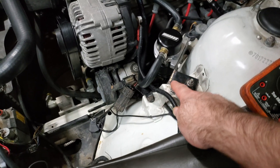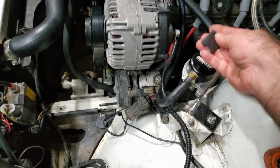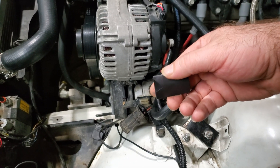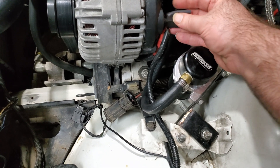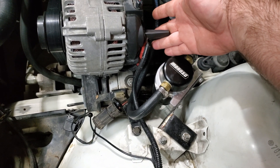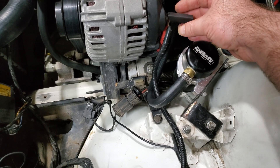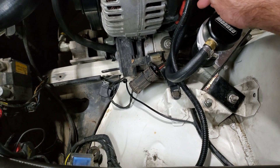Now I did move this back over here a bolt because I'm kind of weary of this pole on the alternator. So I cut off a piece of heat shrink, cut a little divot in it for the cord to go, and do my best to cover it just the best I can to protect it in case a motor mount or something crazy breaks, or this comes off its stud and comes loose and grounds off on the car, catches it on fire or something. So let's go ahead and do that.